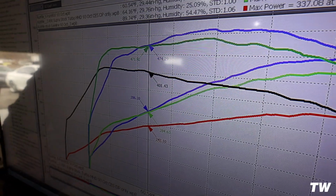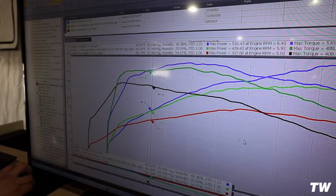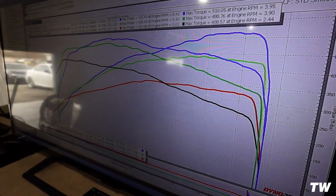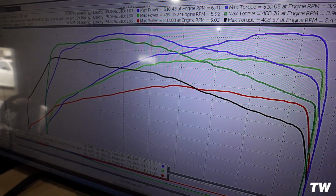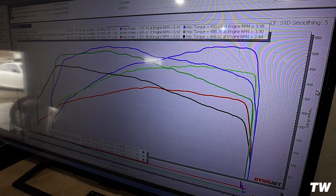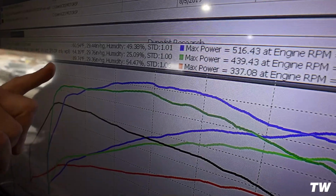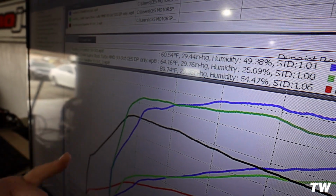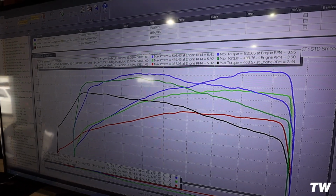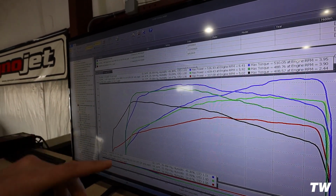And it doesn't have quite the jump that the stock turbo does here. So spool is a little bit slower, but drivability, if anybody has driven one of these before, knows how jumpy the Supra can be because the torque is literally instant when you drop the hammer. This helps smooth that out just a little bit, but still not much of a difference in spool. And you could see the dyno runs for Mike's was actually even in 90-degree temps. Hotter, so the spool differential is going to be even greater. Yeah, I feel like it's much more smooth with the 800. I feel like the 800 fits these cars much better.